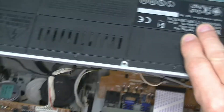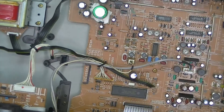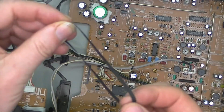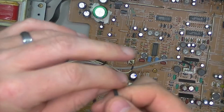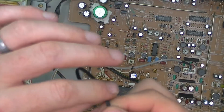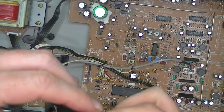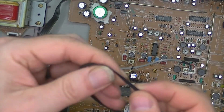Something you can often tell with a deck is if they start squeaking as well — it's usually a sign that the belt is really hard like this one, with no elasticity in it. That means the plastic spindle can't get a grip so it just polishes it and makes it shiny, which is what's happened here.